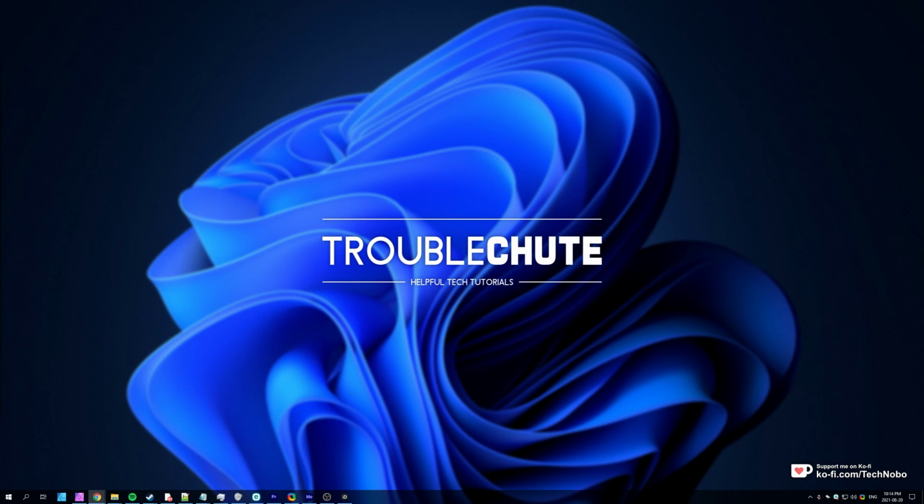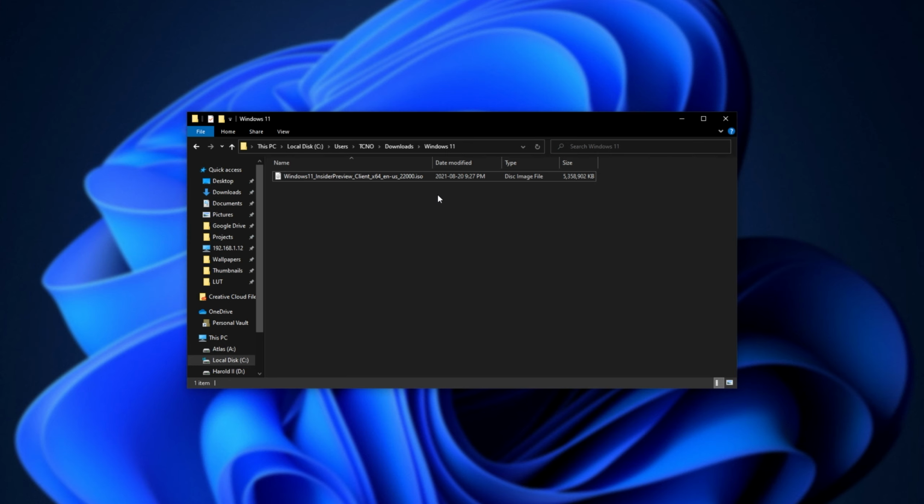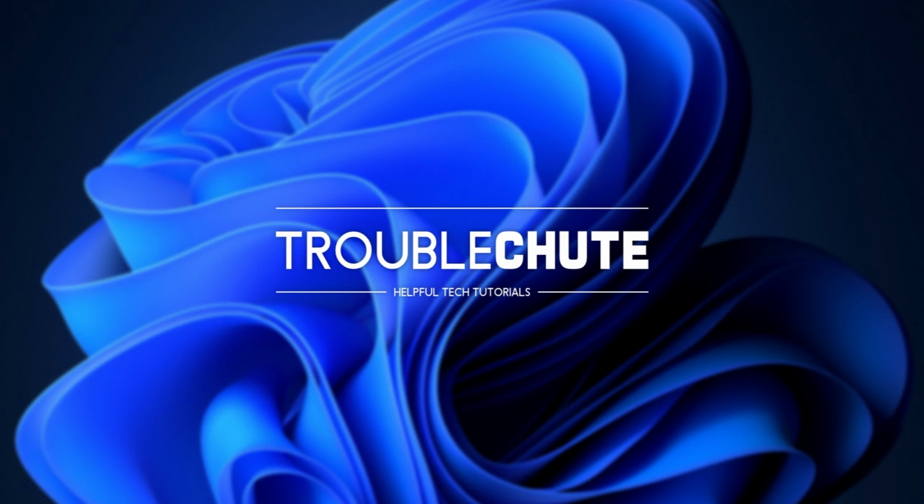When you do eventually have the ISO, you'll have something like this in your downloads folder, taking up roughly 5 gigs. In order to actually put this on a USB, you need a USB that's probably around 8 gigabytes or so, and of course make sure it's completely empty, nothing important is stored on it, as we'll be wiping it to put the Windows 11 install media onto it to boot other computers to it.